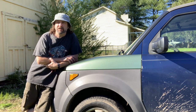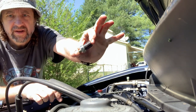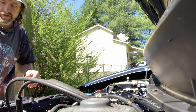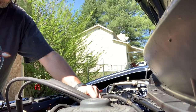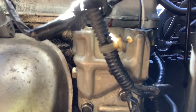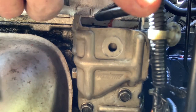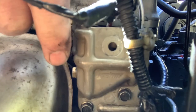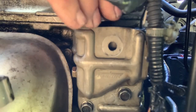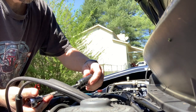Hi kids, here's a quick update on the VTEC saga because I had an idea this morning. There's one other thing I can try before I replace the entire VTEC — I can replace this oil pressure switch. This is a relatively new one I bought a while back. It's really hard to see because this heat shield is in the way. I'll pop the wiring harness loose and take this 22mm socket and put it right down inside this hole over the switch.